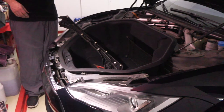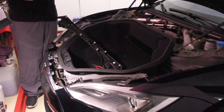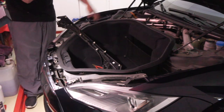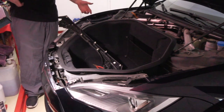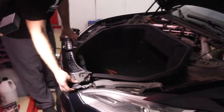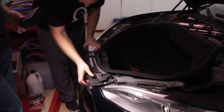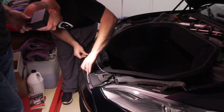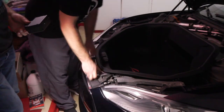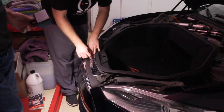And if you parked the car with almost no energy left in the pack, you would have to kill the pack in order to keep the brains online. So you would end up with dead main packs because somebody parked their car for a month and went on vacation, instead of just having a dead 12 volt battery. They had to replace a few battery packs that went bad because of that. And then they realized, oh yeah, we need a 12 volt battery. That's what needs to die when somebody does this, not the big battery.